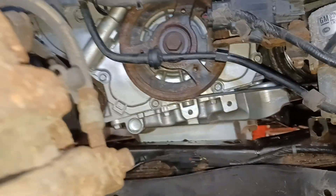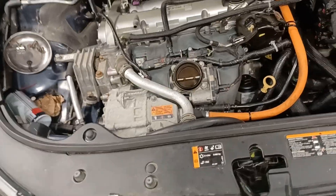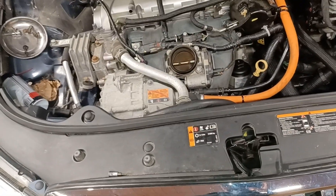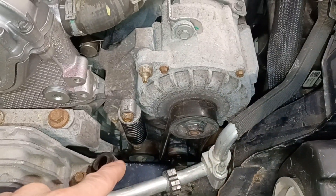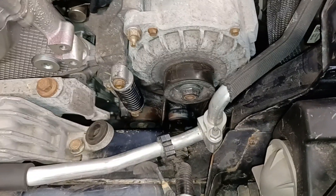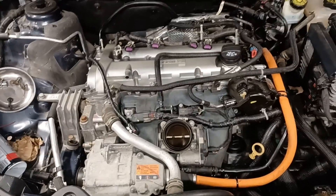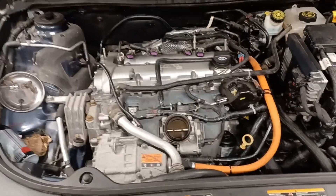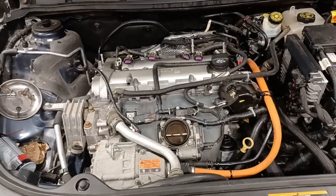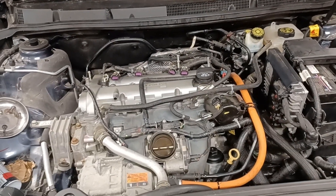All said and done — the first time is always a pain. Getting that belt back on, I had to have my wife come out and hold a wrench and push the belt on while I was prying on that 19-millimeter boss, but I got it back on. Once you do it you're like, okay, I could do this again. I'm about to fill antifreeze, put some oil in here, crank it over for a while before starting it just to make sure it's primed up, then put power to everything and let it go. It's a 2013 Buick LaCrosse 2.4 hybrid — not a terrible job. You can lift it with a cherry picker and take it out the top, saving yourself from replacing subframe bolts and dealing with alignment.